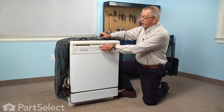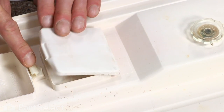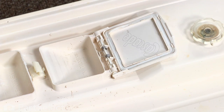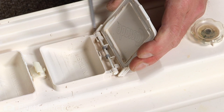The first step in this repair will be to open the dishwasher door fully open, unlatch the detergent cup lid, and then with the flat blade screwdriver we will go in between the pin that secures the lid hinge and the lid itself and pry the lid away from the pin.